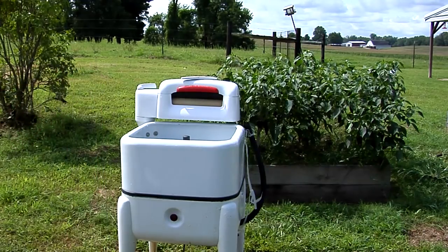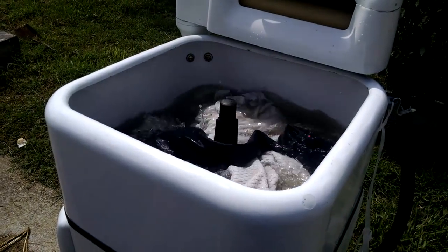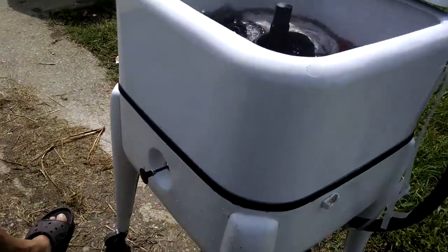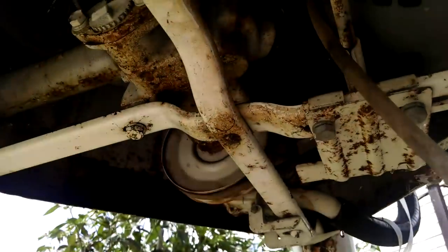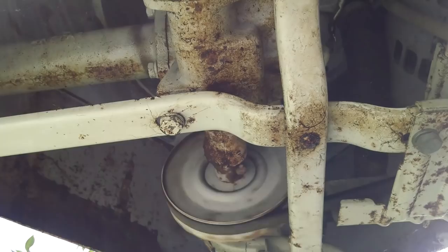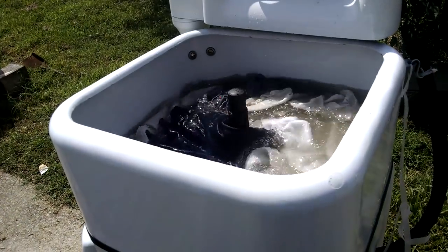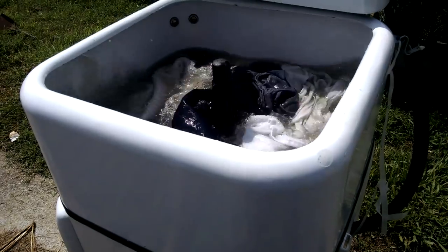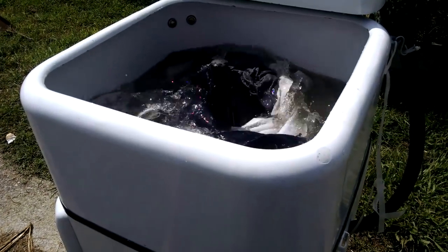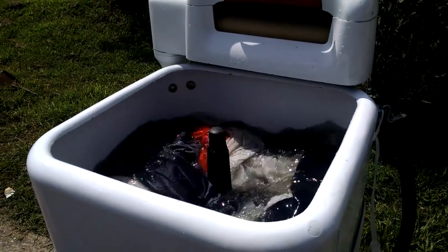This is a 1940 Maytag — it's about 76 years old. Can't kill the thing; there's nothing to it. The only thing that powers it is a half-horsepower motor that I installed underneath, and it drives the agitator. There are no pumps; it's just gravity. You have to load it by bucket and then you drain it by gravity. When you want it dry, there's no spin cycle — you run it through these rollers, and it's much drier than a typical washing machine we have today.